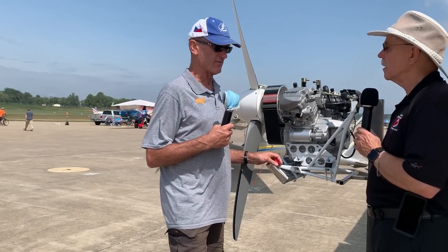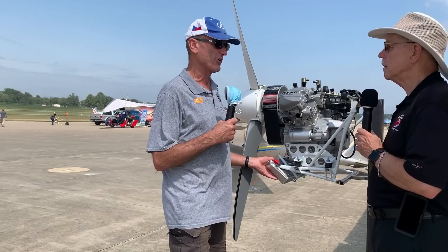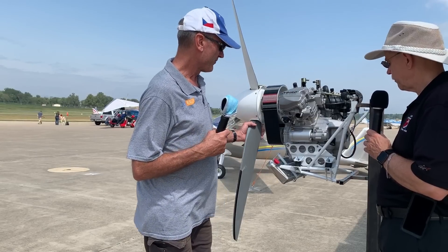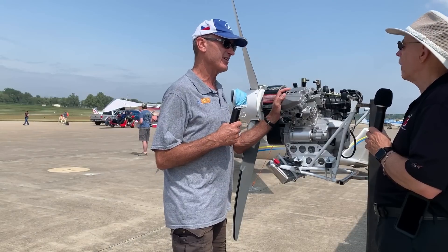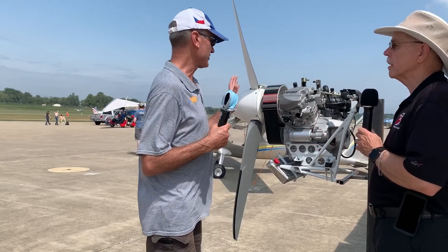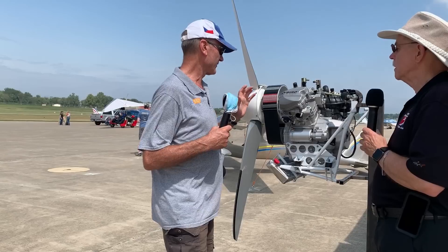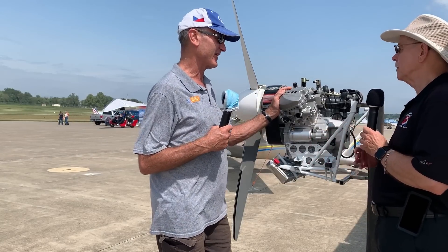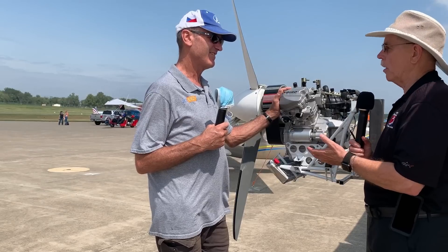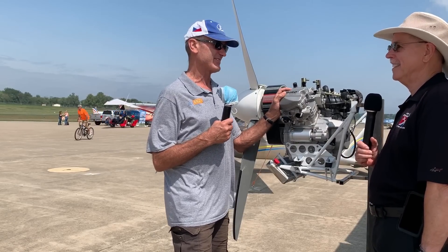Because the Merlin is a fast aircraft, we don't need a huge radiator. This radiator is actually bigger than the ones Rotax uses to cool 100 horsepower, so it's getting plenty of cooling capacity — we'll probably go a little smaller on it. We also have an electronic throttle, which is really unique, giving us almost a FADEC-like system. The only difference from true FADEC is you don't have an adjustable prop, though you could since it's experimental. But that level of complexity isn't necessary for 60 horsepower. On the Merlin, that much power sets you back in the seat — it's exhilarating, a blast.